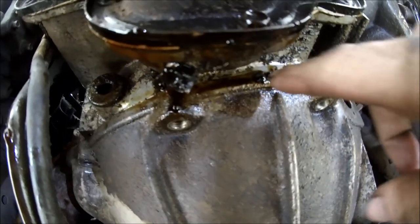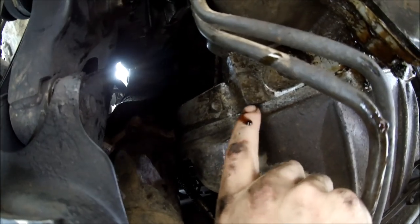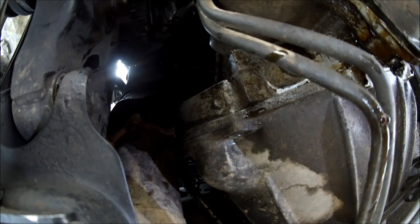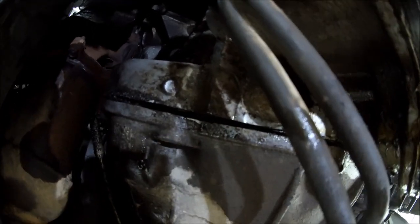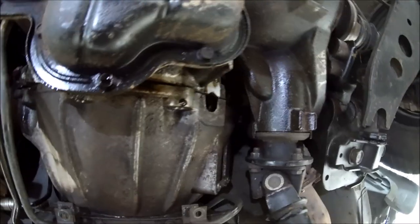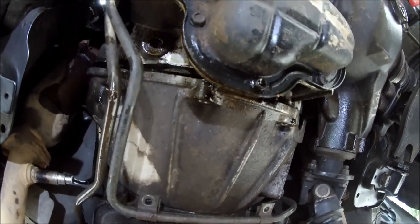One thing I'm going to do is put a screwdriver in here and pry apart. It'll make a hairline crack seam right here. I'm just going to shove flathead screwdrivers in here and work my way up to pry this off. This dowel pin up towards the top is what's holding this on right now. So we have a bit of a gap showing here. Not so much on the other side. Kind of pivot it that way. Okay, looks like it's free.